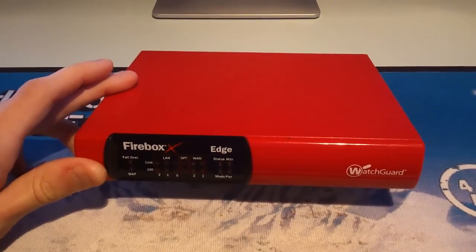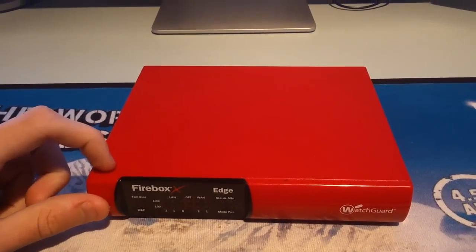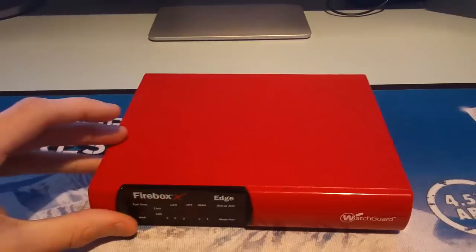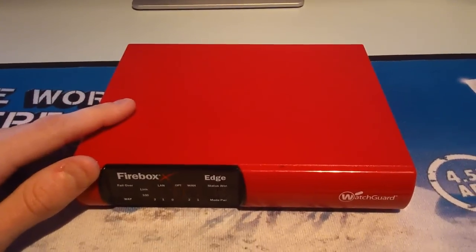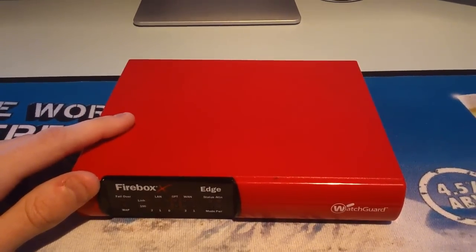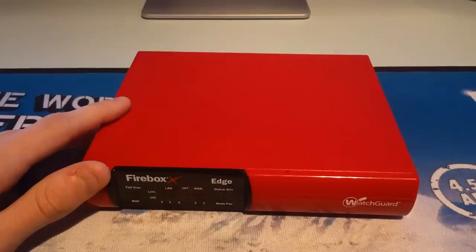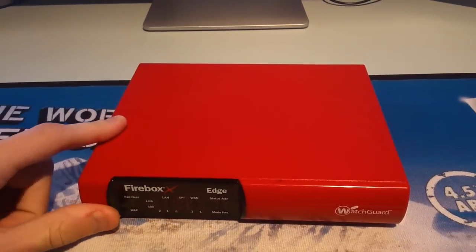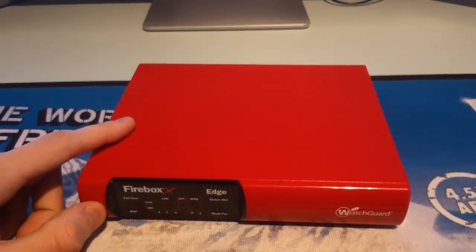I just wanted to show you around the device, and then in the next video I'm going to show you how you can connect this thing up. In the video after that, I'm going to show you pretty much how you can get this thing working online — set up VPN, show you the NAT settings, how to port forward, and how I'm going to set this up on my current router. Surprise, surprise — you can't actually change the NAT settings on it, which sucks. So as soon as I put this thing in, I'm pretty much double NATting, and it screws up my network whenever I try to do firewall rules.